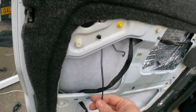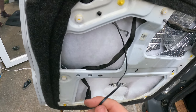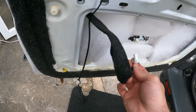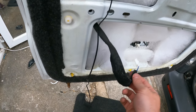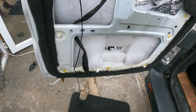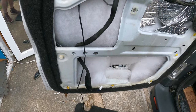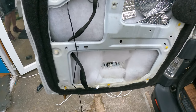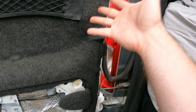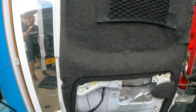What I'm going to do is power this with the number plate light — I'm just going to tap into the number plate light. This does mean the reverse camera will only work when the lights are on, but it's easier to switch the lights on to see the reverse camera. So that's going to be fine, and then I don't need to worry about trying to get the cable from this door into the rest of the van. So I'm going to tap into this wire and then put this door back together.